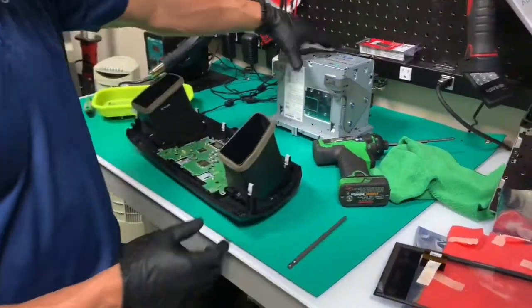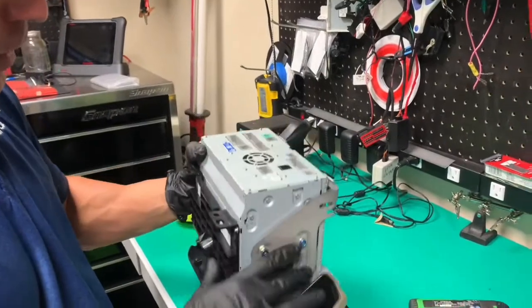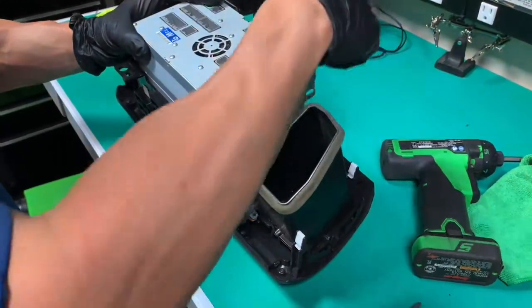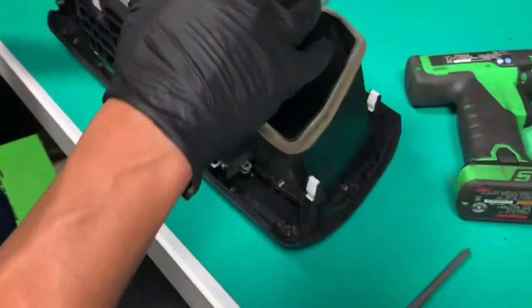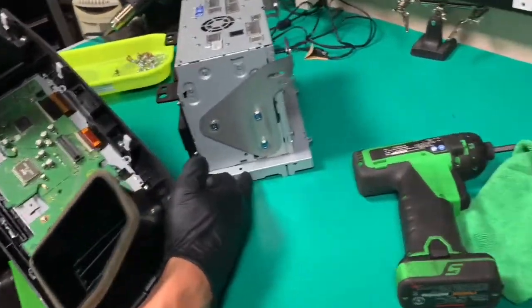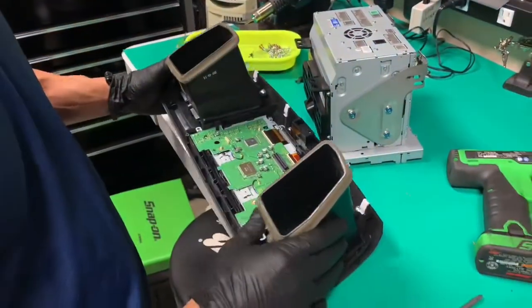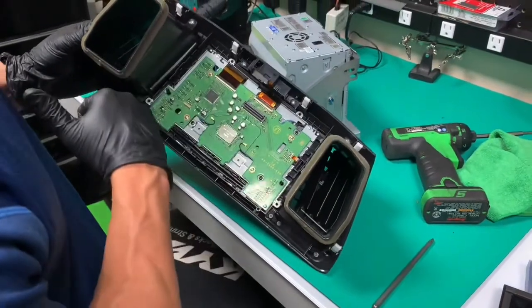Moving on to the unit, I've actually taken the liberty to begin disassembly. To get to this part was very simple. It started down here and we removed six Phillips head screws that hold this to the face plate. You'll see two on the top and two on each bottom corner there. With those removed I had to gently pry these little plastic tabs on the sides that also latch on to this unit here. Just gently pry them one at a time off and this whole brain here is going to pop off. Once we've got the back of the LCD, we're just going to remove these four small Phillips head screws.